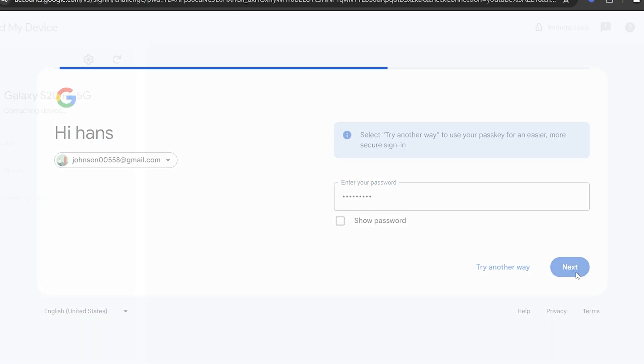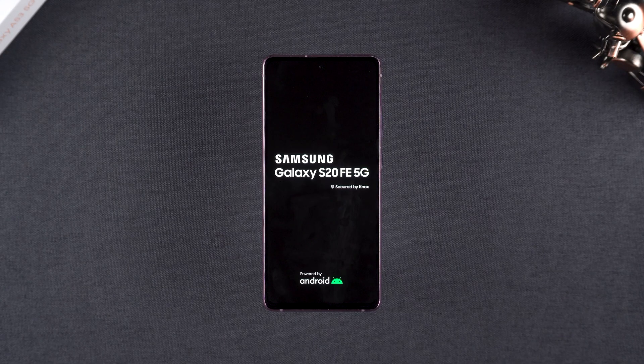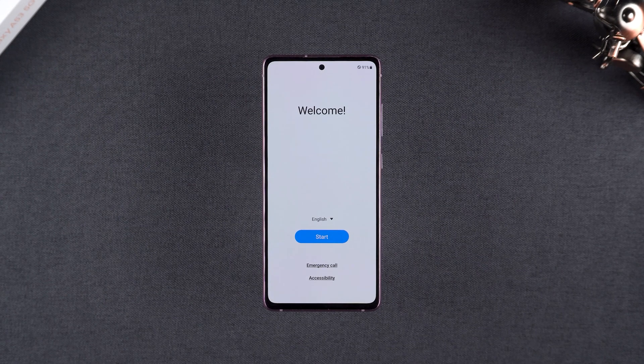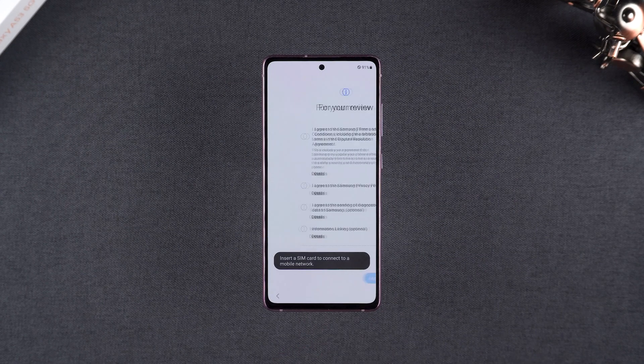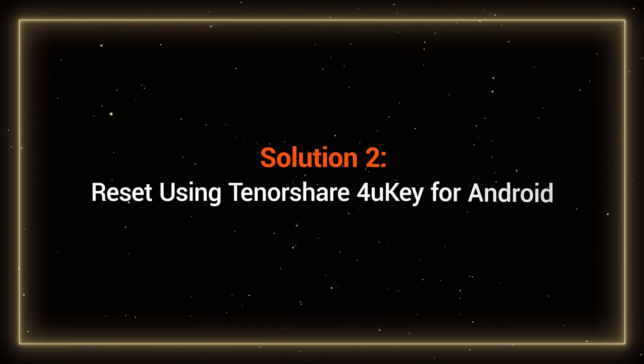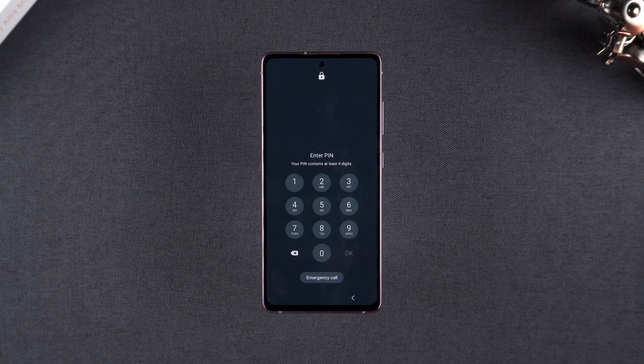You will need to enter your password again to complete the confirmation. This will remotely reset your phone to factory settings, erasing everything including the lock screen. After your Android phone reboots, the reset is complete. Keep in mind that your phone must have an active internet connection for this method to work.